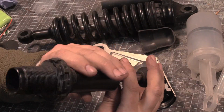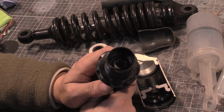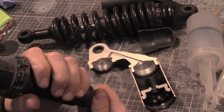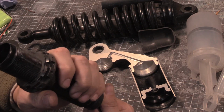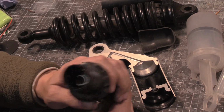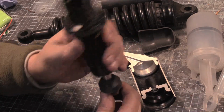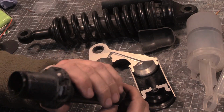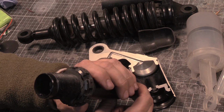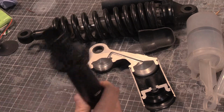There's a locking ring in the bottom with a screw. The only thing I will say that's good is that the shaft on the end, you can hardly see it, is staked with a nut on. But apart from that, I'd love to take that out, but I ain't getting that nut off anytime this century. Even that nut won't give me enough purchase to get on there, because they've staked the shaft onto the end of the nut in 3 points, so I ain't getting that off without really damaging something. And it wouldn't matter, you'd just get to see the shoddy seal they've got in there.